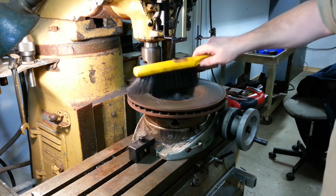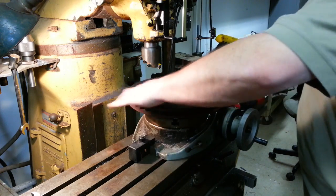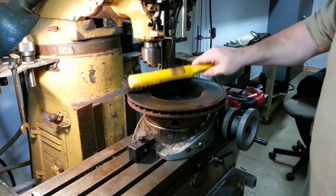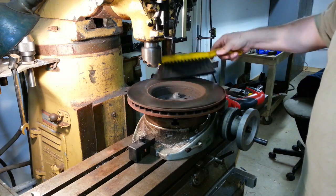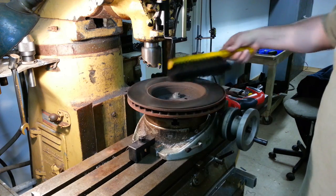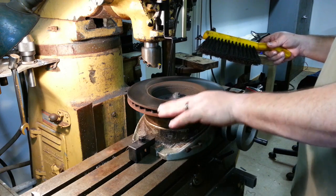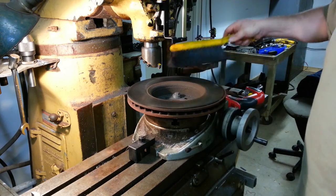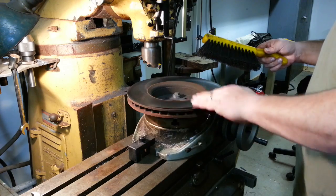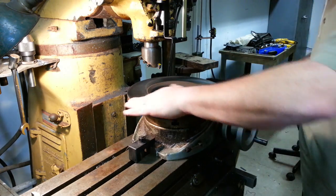On this first pass it didn't clean up completely, so I'm going to have to make a finish pass obviously, but that finish is actually really, really nice. I'll have to come in for a close-up and show you. When you buy rotors they're usually Blanchard ground so that they have a little bit of texture which allows the pad to bite and bed whenever you turn a set of rotors in a lathe machine. Once you're done turning it you actually have to take some 220-grit sandpaper to rough the surface up to give it some bite so you can bed the new pads. With this technique you already have a little bit of bite in the surface just like it was Blanchard ground, so you don't really have to worry about hitting it with sandpaper — it's got a really nice finish.